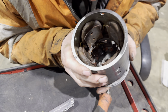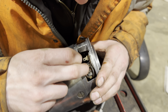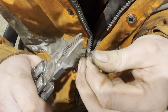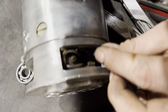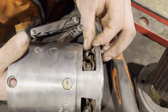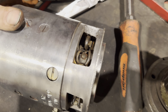That's in. Now I've just got to repair this spring. In here there are these little springs that push down on the brushes, and this one is broken because it's rotted away. I'm going to see if I can repair it and fit it back on. Spring steel isn't the easiest to work with, but because this end rotted off I think I can manage. This spring isn't going to be quite as good as its mates, but it's going to work just fine.